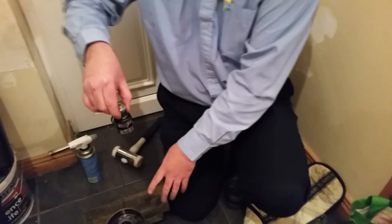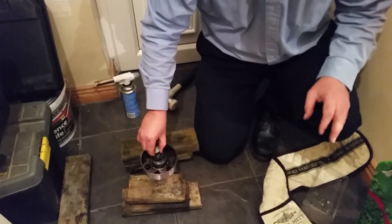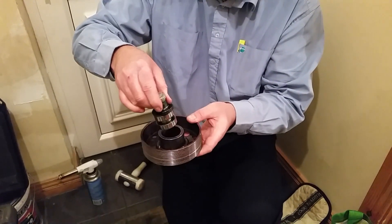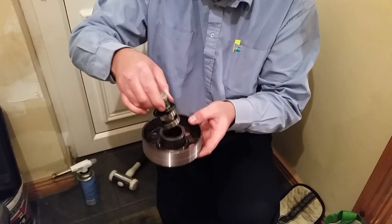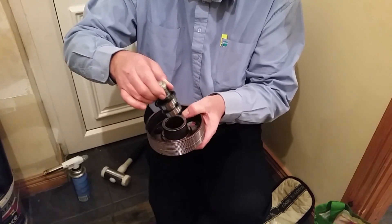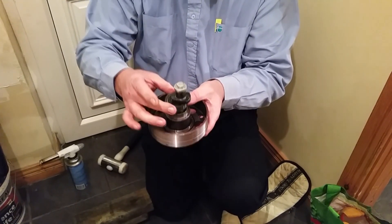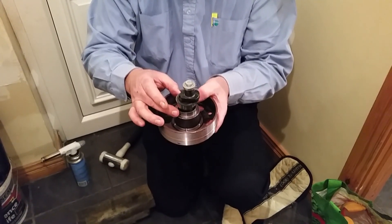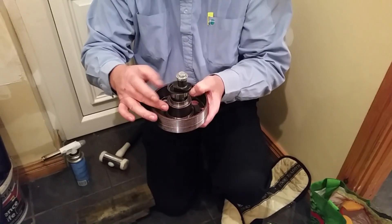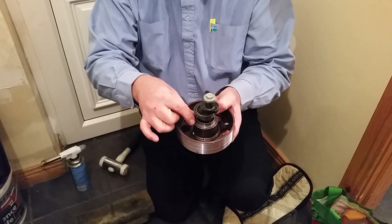Because when you heat this for 40 seconds and no more than 40 seconds, this will drop straight out. Obviously this is cold again so it's not going to go on right away. Heating it is the only way to get this to drop on — grease won't do it. So once it's heated for 40 seconds and you drop this in, if you have the spring already around here she'll drop on perfect, she'll seal tight. Let it cool down and then just fit your spring in. If you don't do that and your spring is out, this goes right through and you'll not get your spring out.